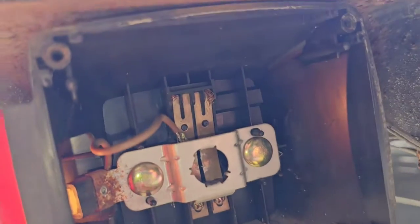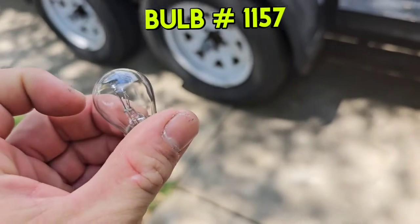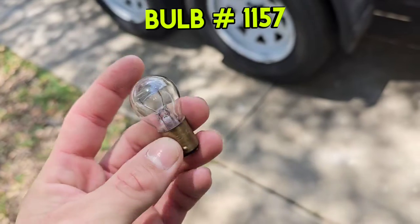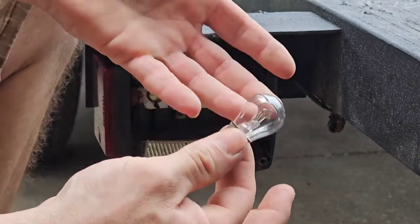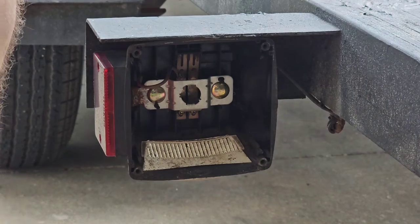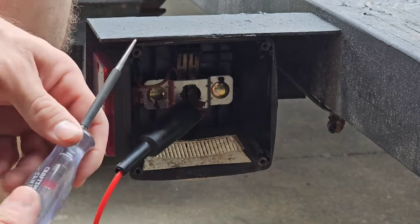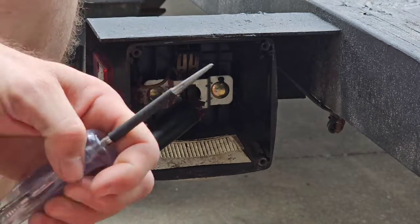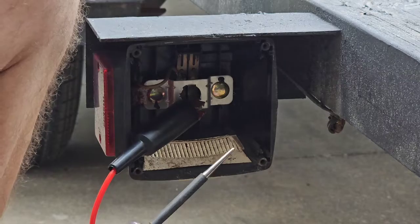Here's a closer look at what I was doing. This is the wire that's not working — and this one is working. These bulbs do burn out so often that I carry a spare set in my vehicle anytime I'm pulling a trailer. The best way to test is either using a multimeter or a test light. I'll put the ground on a good clean ground plate right here. The reason it may not have worked with the light is that wire might be a little corroded and not making a good contact with the light — it could be a connection issue right here.